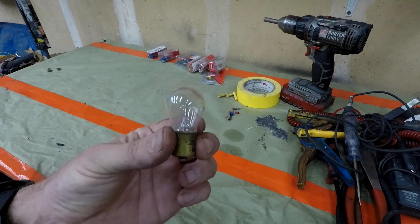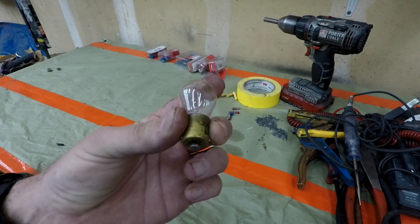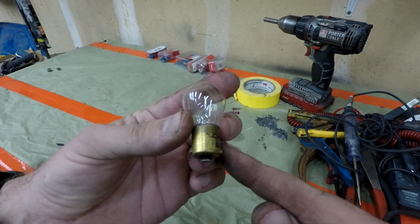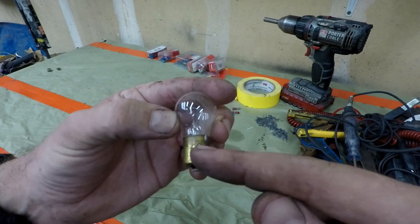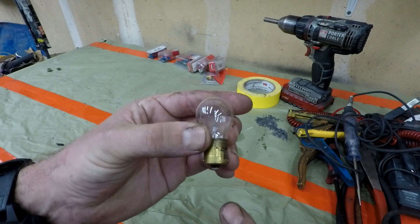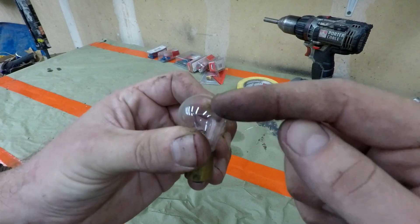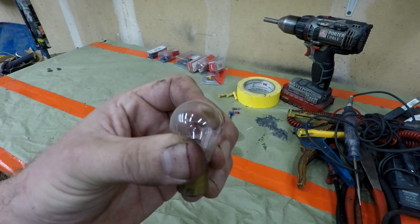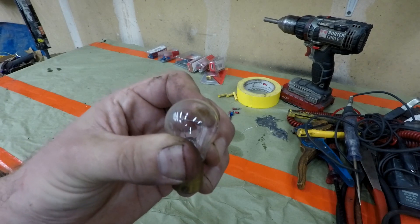To further lock in this concept, let's take a look at a standard light bulb - the kind you would find in any vehicle. On the bottom is the little post where electricity goes in, and around the sides is actually where it grounds. When you put this into its little holder, those little pins lock in and that is what gives it a ground. Electricity goes in through the bottom and runs through the filament. Electricity wants to go through as fast as possible. The filament offers resistance - think friction. And what do you get with friction? You get heat, and in the case of electricity, you get heat and light.